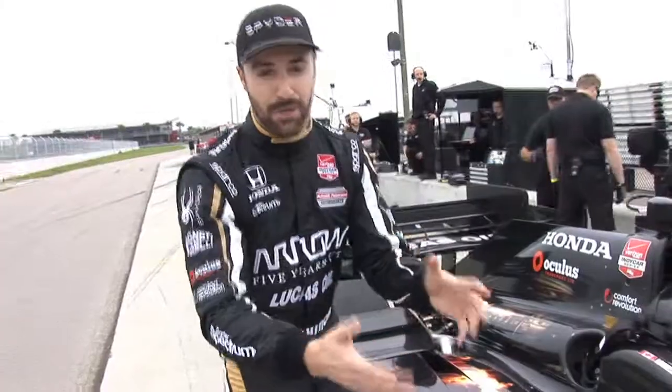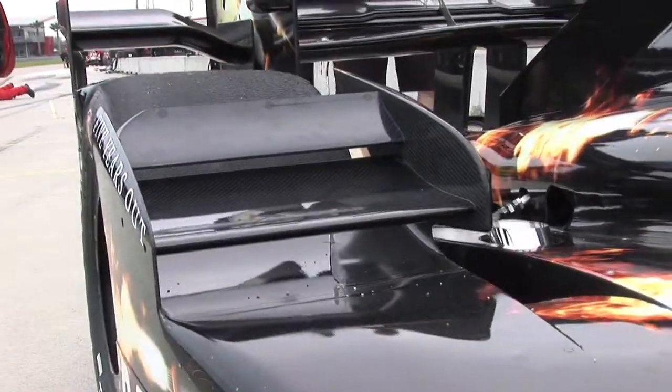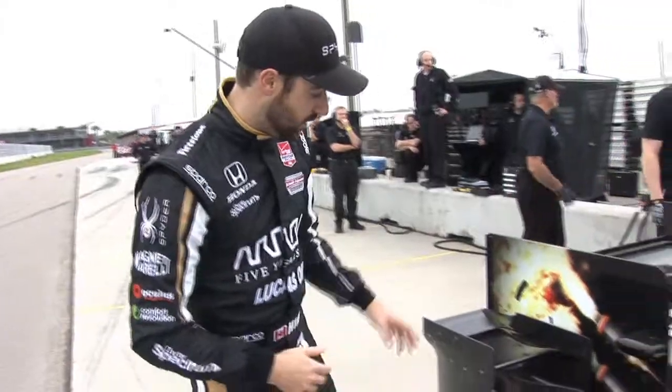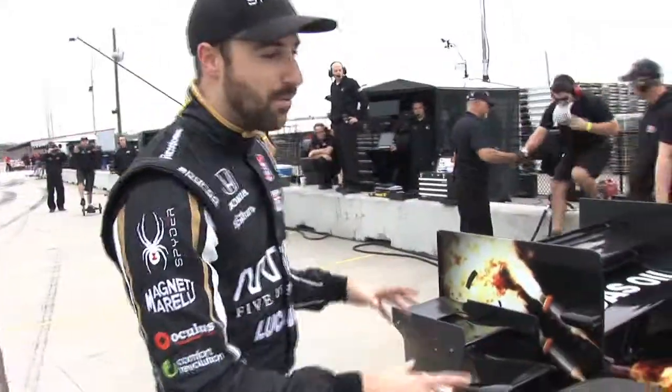But we made that all up, not only with the front wing, but also the rear wing. Rear downforce starts here in the tire flip and obviously extends to a multi-element rear wing. We're now up to four elements in the back of the car, as well as additional winglets on top of the bumper pods. All these bolt-on bits are all tunable, all adjustable — you can add and remove them as you like. The whole goal is to get as much maximum downforce out of the car for as little drag as possible.